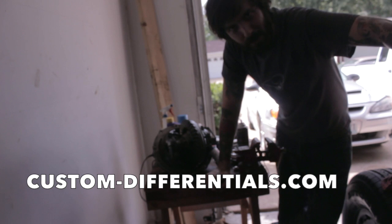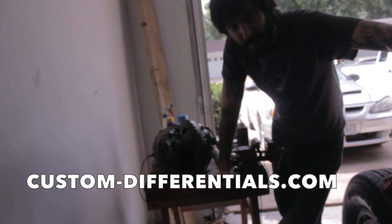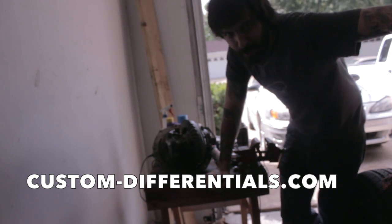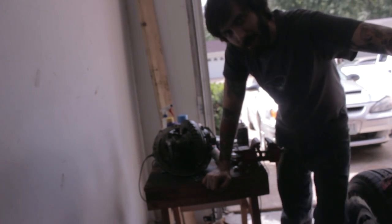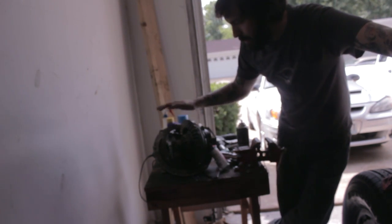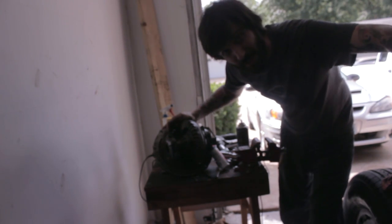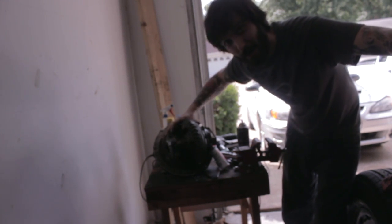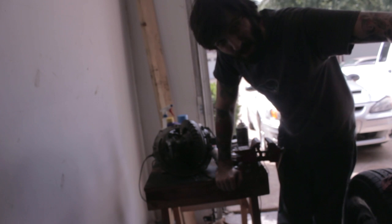We found a place 60 miles south of St. Louis called Custom Differentials — man, do they have everything. Cool setup, check them out, they have a website. The guy does work all over the country, so if you need something he can probably hook you up. I went and traded mine in for the core and paid a reasonable price for a complete third member dropout. This is the third member — it has all the gears and stuff. Differentials are confusing like transmissions, so if you know what you're doing you can get inside them, but if you don't, you shouldn't. That's why we just had the entire third member swapped. It's a 31-spline axle, same as mine, and it's 3.50 gears which has got more low end — not super low, but a lot better than the 3.00.